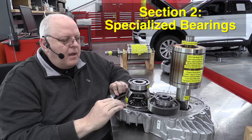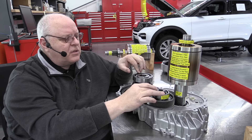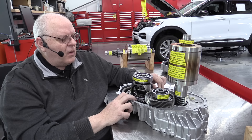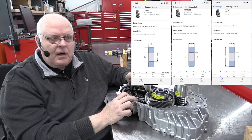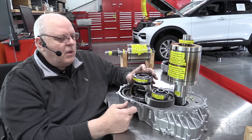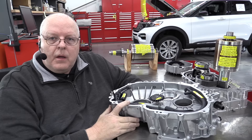So in the first part of the video we talked about the gears, and we've also talked about how fast this rotor and these bearings have to rotate. We talked about the special SKF bearings and their special design for these Tesla motors. If you go to the SKF website you can download a catalog, or they also have an app where you can look up bearing specs. You can see data in the screenshots here showing the maximum RPM recommended for these bearings. Tesla does something special with these bearings to make sure they can withstand higher RPMs than their standard mechanical speed limit.